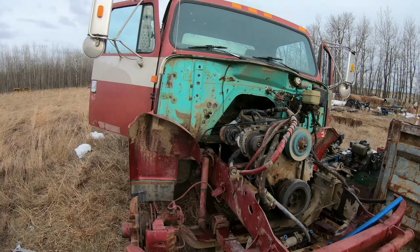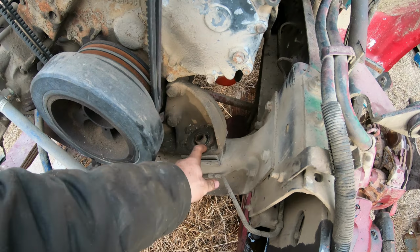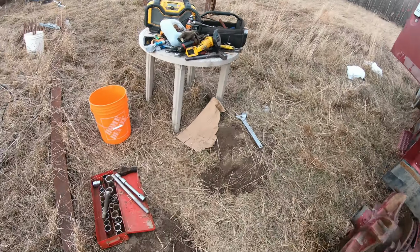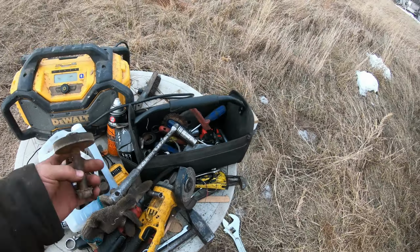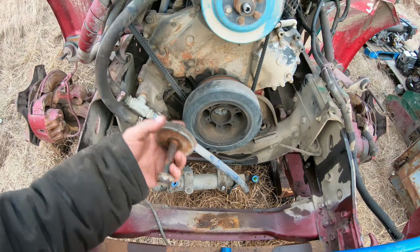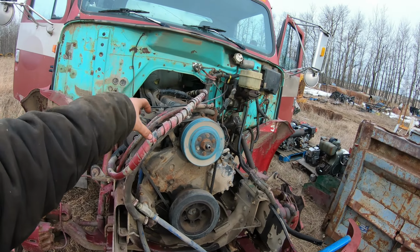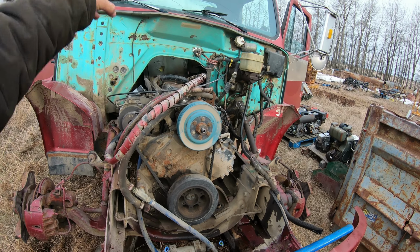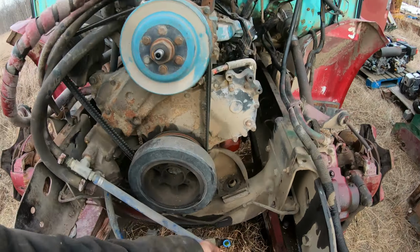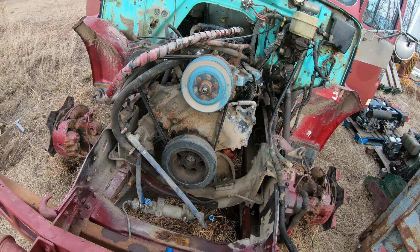Okay, I got the 4 motor mounts unbolted. Just one there, one at the back, one at the other back. They just look like that. They bolt down from the top and has the big washer on the bottom. That's so you can set the whole engine and tranny right in there. So you just pick it up, pull it out, or put the new one back in, drop it down. The pins on the motor mount center it, and you bolt it in place.